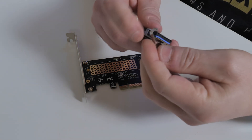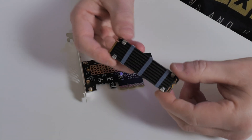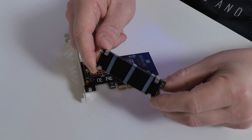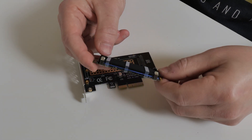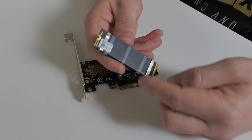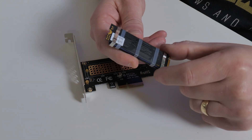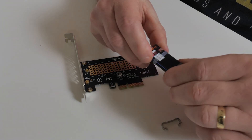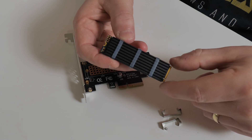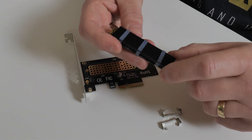Put the last clip on and it clips around the outside edge. You can see the heatsink is now very, very well attached, and looking through the side you can see the thermal pad in place. If you have a drive with additional mounted components on it, I would advise against using the metal brackets in case they short anything out — in that case just use the silicon bands on their own, which is absolutely fine. These are silicon-based bands so they're resistant to high temperatures, though obviously the heatsink itself is designed to reduce those temperatures.